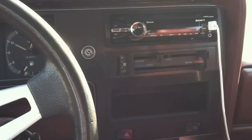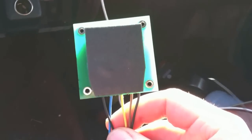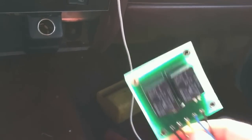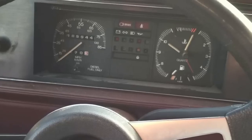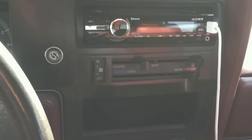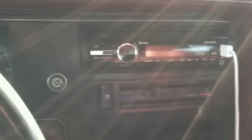Let's get into this now. I'm going to demonstrate my new circuit board — this is my latching relay circuit. This will keep your car stereo going after you turn off the ignition until you open the driver's door. Here I've got my car; I'm going to install one in it and demonstrate before and after. This is a really old Volkswagen Rabbit, 1981, so it doesn't have the nice new feature of modern cars where you get to your destination, turn off your ignition, and the radio stays on.